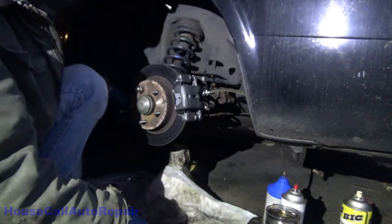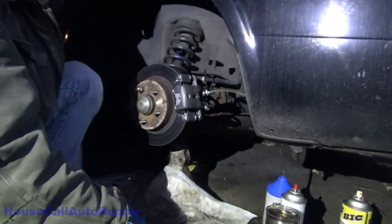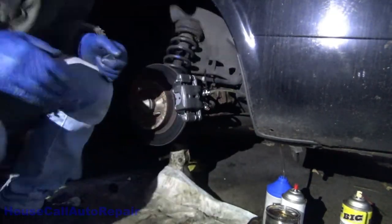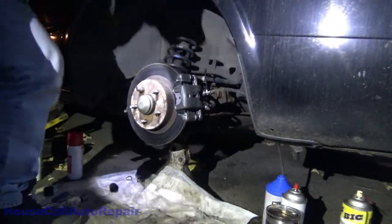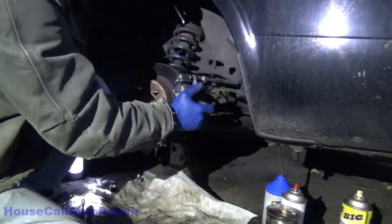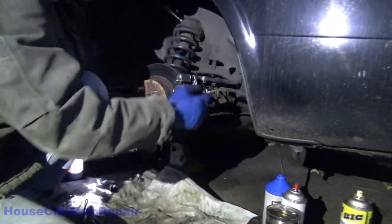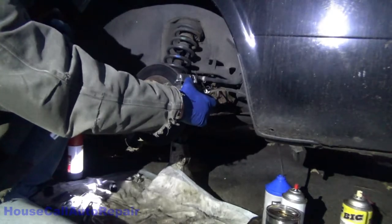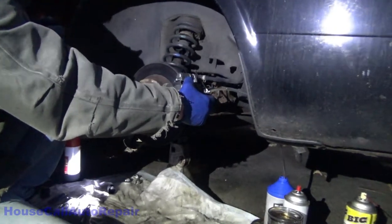Okay, hold up. Let's check your brake fluid and make sure it's full. Stop pumping and yep. Put it down. Just leave it up. Now, let's see. Fresh brake fluid. Okay, push it down and hold it. Okay, just wanted to make sure that the piston was moving. All right, go ahead and pump it two or three times. Okay, hold it down nice and firm.